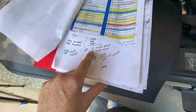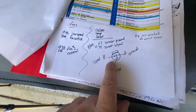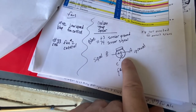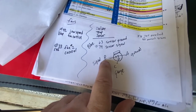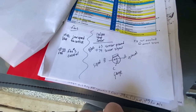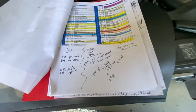Pin 63 is the sensor ground and pin 74 is the engine coolant temperature sensor signal. Looking at a pinout of what the actual harness looks like, there are three positions or three pins. The lower pin is for the gauge signal, pin B is the sensor signal, and pin A is the ground. So let's test those wires and see if they function properly and confirm the correct pin positions.